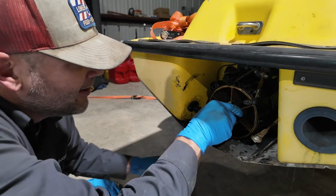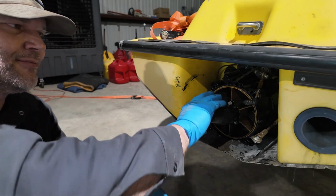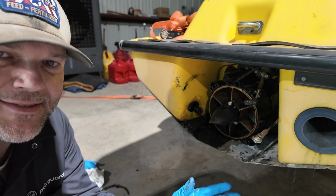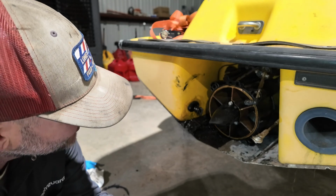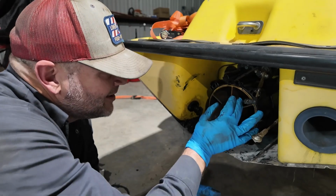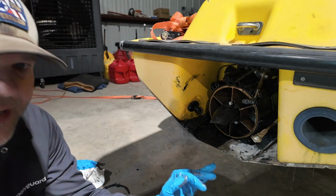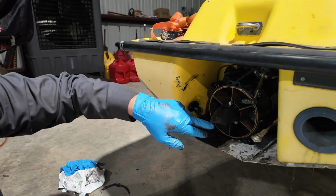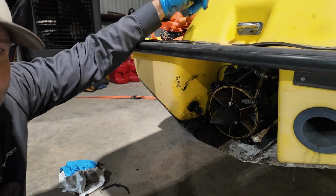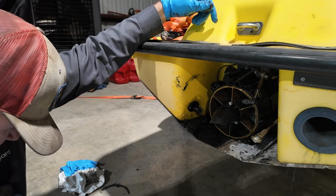But I'm gonna make sure my shaft engaged with my impeller, and then I'm gonna hook up the hose on the inside before I forget, because that'd be typically something that I would do. But I'm gonna make sure that shaft is engaged. It feels, I would say, like it went right on. That's kind of shocking, but I'm gonna go ahead, look at that, look at the shaft, make sure it's in the right position, check my 3 hoses, and then just start smoking this thing back down. So give me a minute and I'll reposition the camera.